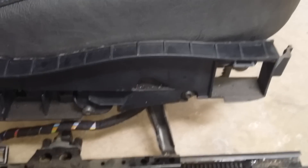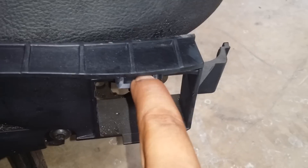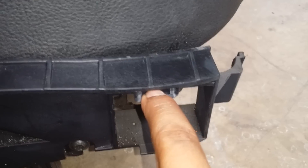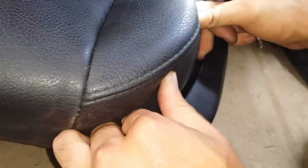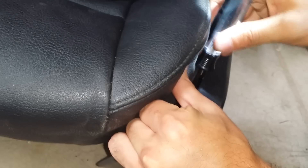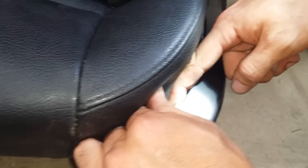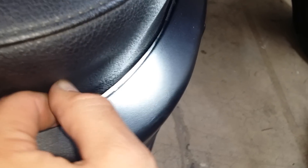I'll show you where those clips go into. Looking at the side, you can see the seat has a bracket here — the top clip goes up here. The way you get access to this clip is with the husky. What you do is pull the cover back and with the husky reach down there, find the pin, press it, and it'll come off. In this case my buddy was able to do it with his finger — push the clip in and it comes off. Then you tilt it and come to the bottom clip — same thing — pop that off from the top and the bottom.